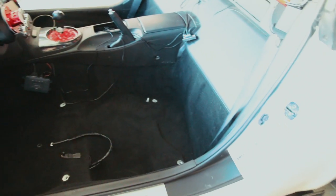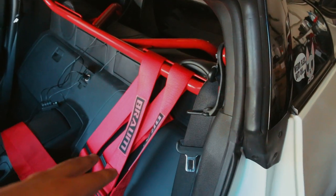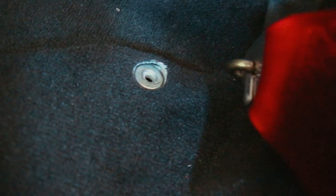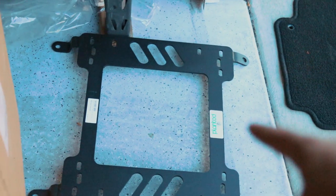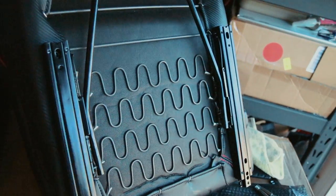For the harness strap, I wove the top two through the harness bar — that won't stay like that permanently. For the left side strap, I unscrewed the bottom bolt that the factory seat belt is connected to, screwed in the Braum ring, kept my factory seat belt connected, and got that strap in. Quick disclaimer: the seat bracket plates are sold separately and don't come with the seats. The sliders — I honestly don't remember if those come with the seats, but we got four sliders, two for each side.